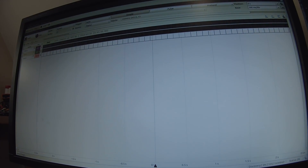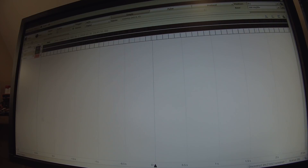So yeah, there we see our pulse train from the resolver output resolving itself. That's about it, guys — we've got the i3 motor spinning with the Hubner board. I think we're probably good enough at this stage to start laying down the groundwork for a logic board to run this thing. At this point I'm not going to be making that design open source, just for the reasons I outlined in a previous video, but we'll see where it all leads.